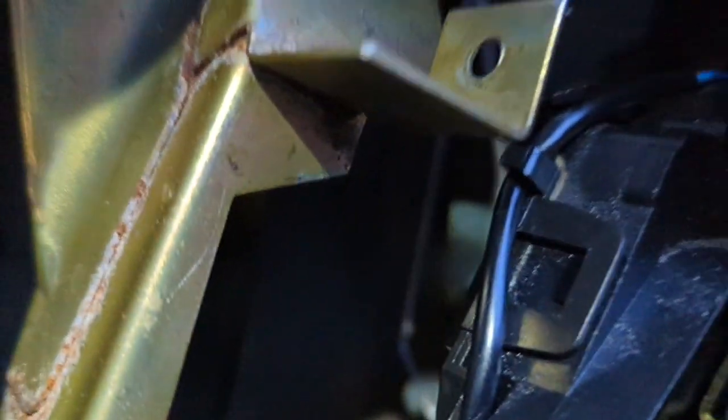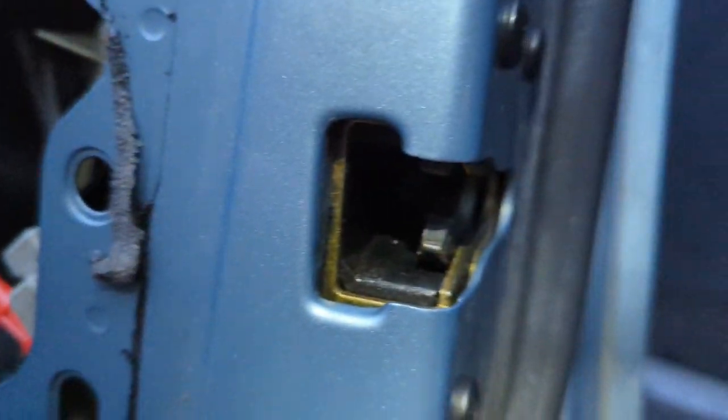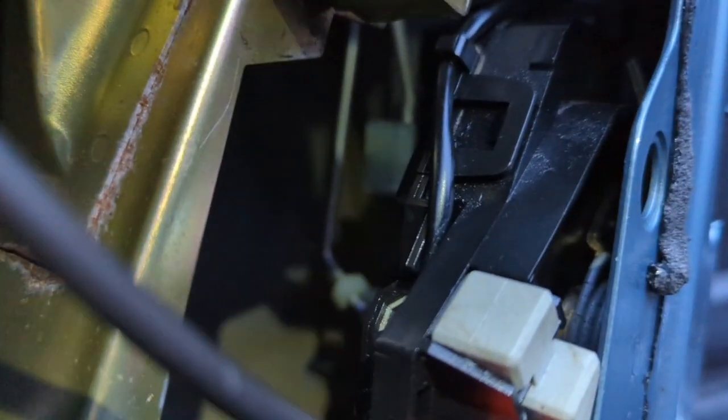Anything else to tell? I don't think so. Oh, what else? Well, it actually started working before I adjusted it as well. What I had done is I'd piled WD-40 inside the mechanism here, all over the rod, all over the angles here. I piled it into this bit too, just to check and see, was it just something else that wasn't quite right? And it started working the following day, almost every time. I think 1 in 20, it didn't open. So maybe the slight adjustment wasn't needed, it was more just WD-40. Can't really tell why that would make a difference. The adjustment seems to be the better option. Anyway, it's been adjusted, it's had WD-40, I'm going to find a screw and put it all back together again.